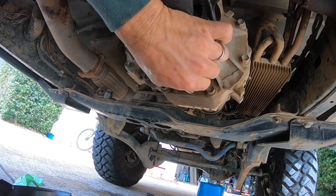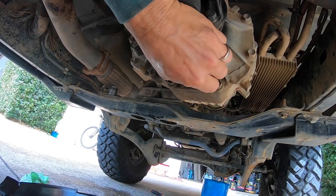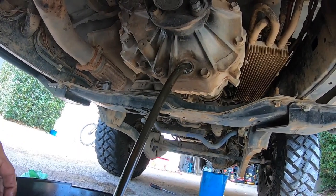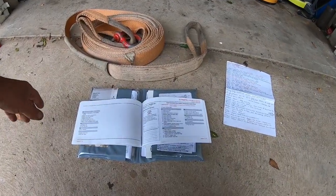On my bullet truck, where rocks have actually smashed that ring into the nut, I've had to grind it down and make it thinner so I can get the drain plug off. Now with that bash plate off we can access this drain plug a lot easier. Let's have a look at what this transfer oil looks like — yeah, it looks pretty good, no water in that.